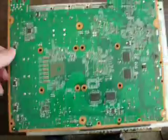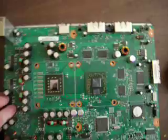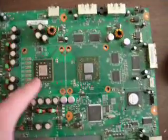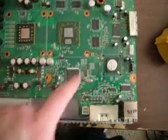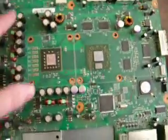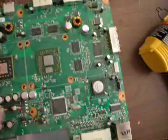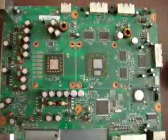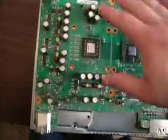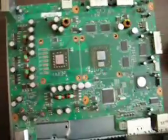All I'm going to do is heat the bottom side here for a minute on the low setting, just evenly covering the whole board and trying to evenly heat it. Then after a minute, flip it over to the top and do four minutes on the high setting, hitting the CPU, GPU, all four RAM chips, Southbridge, HANA, and all the little components in between. Trying to avoid direct heat to the capacitors and plastic pieces — still a good idea to not directly heat those. Just hit the CPU and you'll be fine.